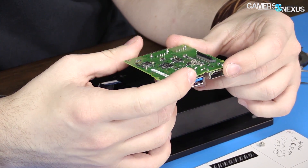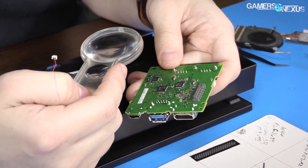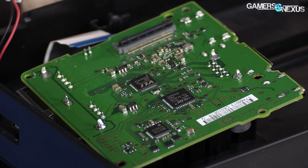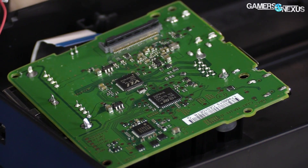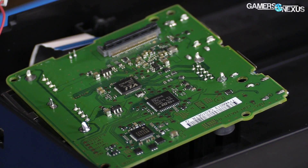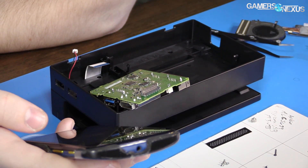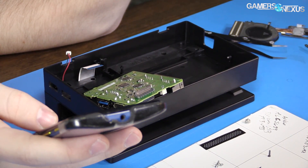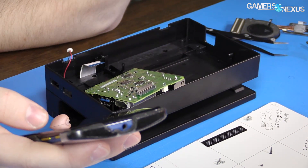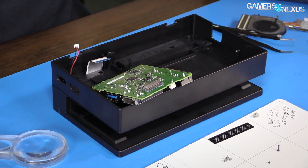This center module — the markings are 32P048 on the top line, CRA on the second line, GH27D93 on the third line, and CHN638 on the fourth line. It's an ST microelectronics controller. I'm not 100% positive, but I believe it's some ARM-based controller. So that's the centerpiece.